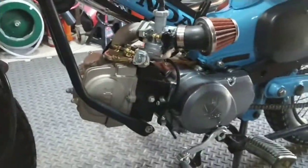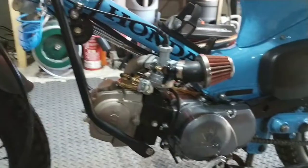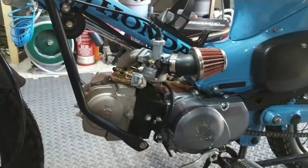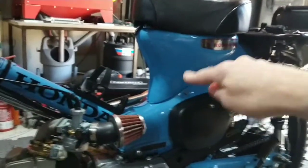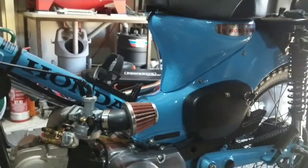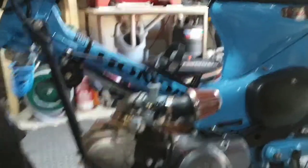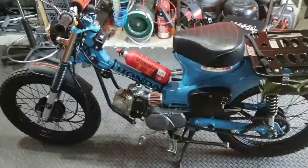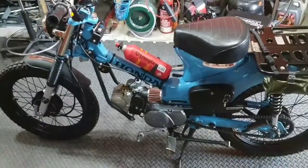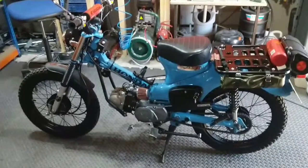It gives me a fuel tap on the carb which I didn't have before, and I've got a fuel filter which you can sort of see in the back there. It's a bit of a pain actually — this bike I've run dry twice now because, as I said in the previous video, the tank is supposed to have two pipes: one halfway up the tank and the other flush as a reserve, but they're both cut off flush so there's no reserve. I've run dry twice and had to do the walk, which is a real pain. I did previously carry a small container for fuel, and as silly as it looks, it is so useful and almost essential, so I might fit that on there somehow or get a different colour — but I do need something like that, because I've done the walk twice now.